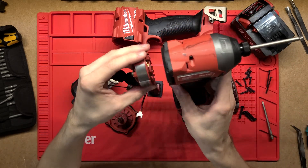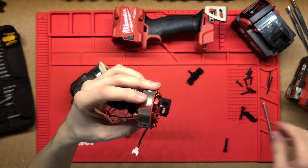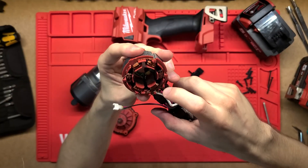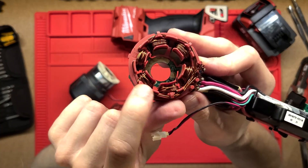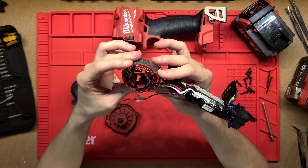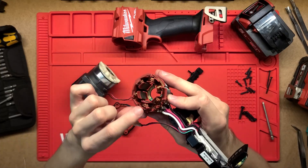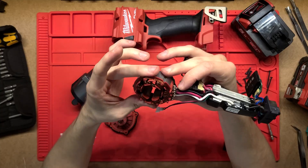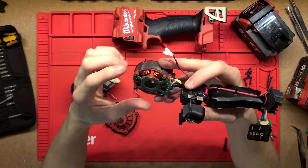I don't think this motor is significantly bigger than what's inside the other impact driver — I think really what it is is that the gearbox is a lot bigger. To be fair on the mid-torque one, as with pretty much all other Milwaukee tools these windings are quite nice and wide. They're not done as neatly as they could be — especially one of them is a bit of a mess — but it doesn't make too much of a difference. The copper wire is quite thick, which allows more current to flow through, lowering resistance, so there's less heating and more current can go through the coils, which means more torque on the actual motor.